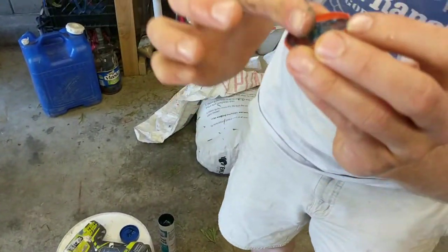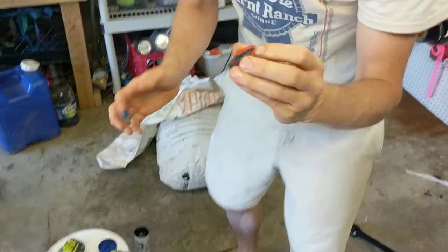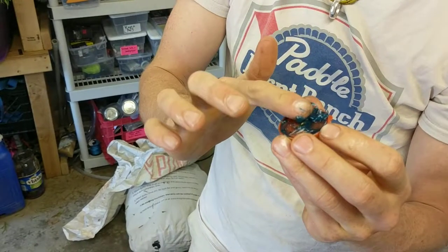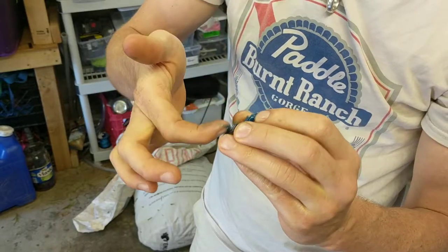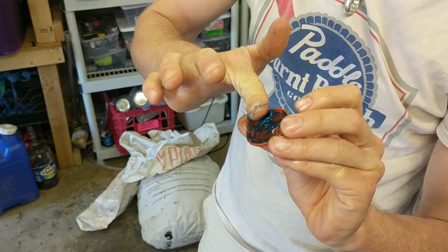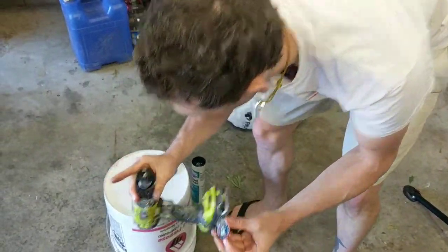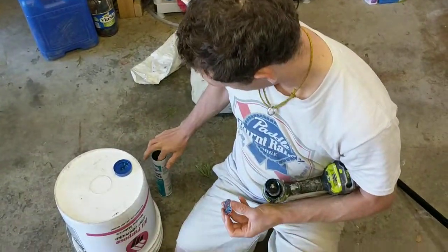Just like if you take apart vacuums — you've probably done trailer bearings — just like you would on a trailer bearing. So now we pack the grease into this concavity. We have this one left — pack some grease in there real quick.